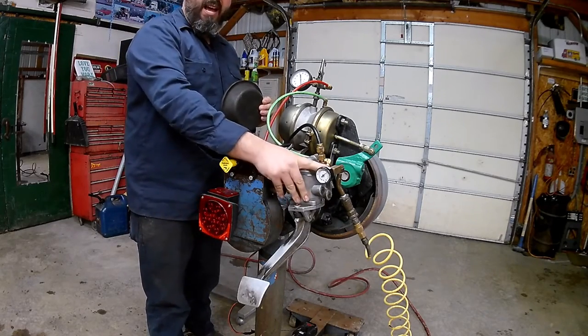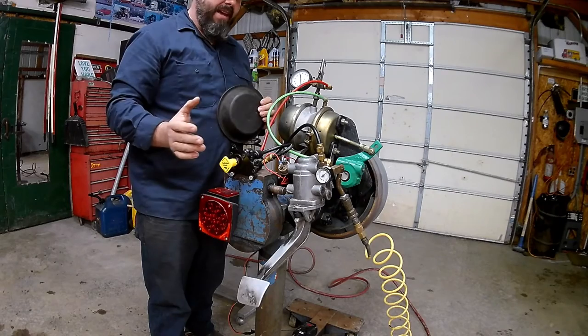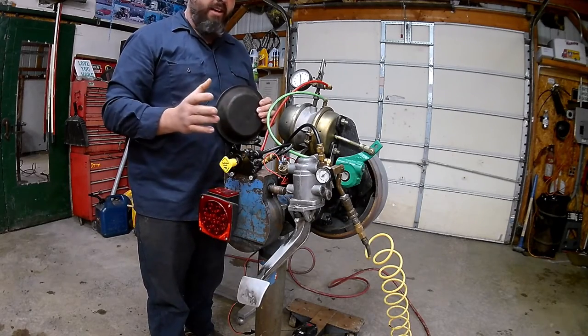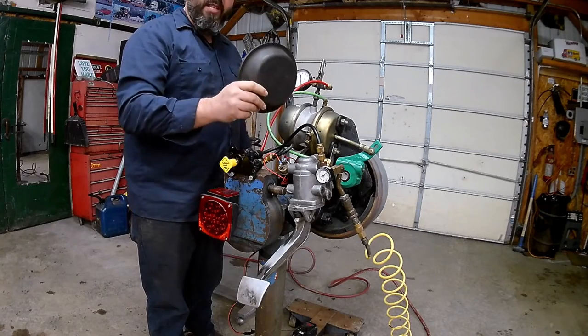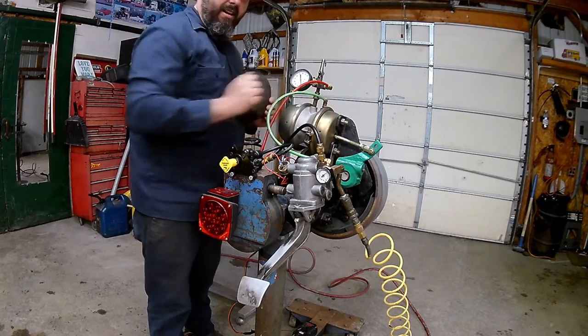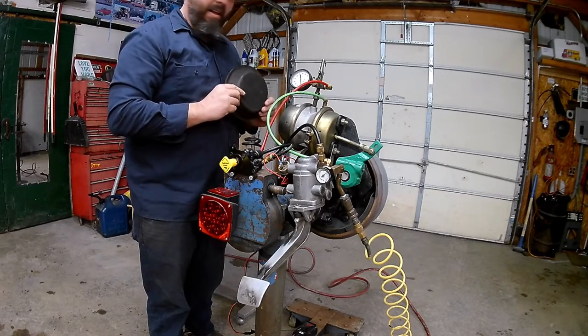We just take our 100 psi — you know, up to 135 psi — but most of the activation pressures are going to be between 80 and 100 psi, pushing out on this disc, pushing out a rod inside here. We'll see in a minute when we tear one apart how it's actually working.